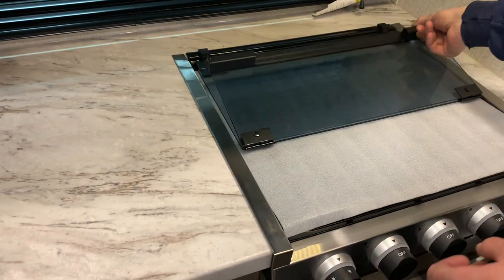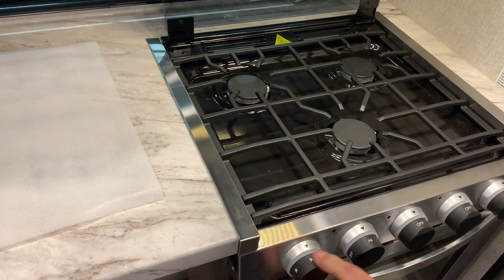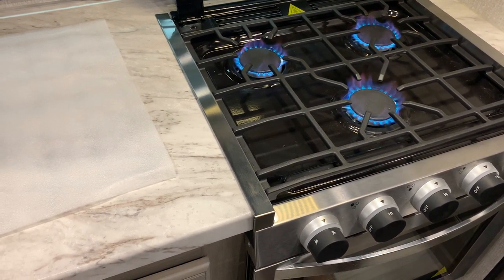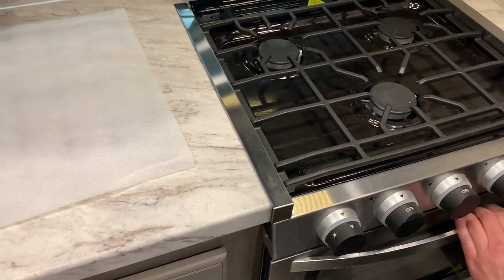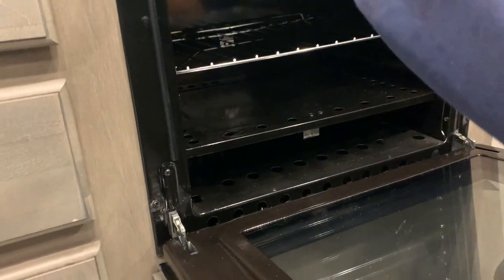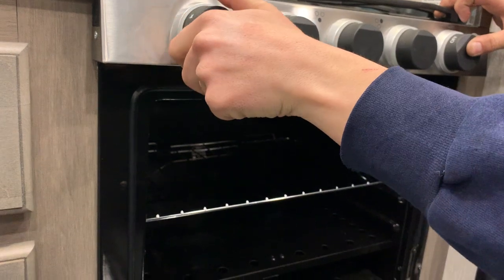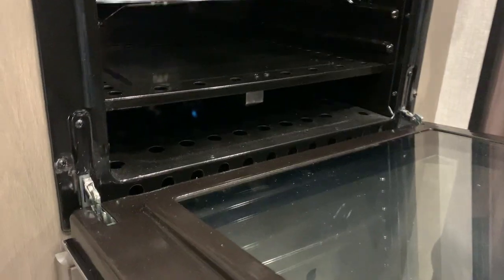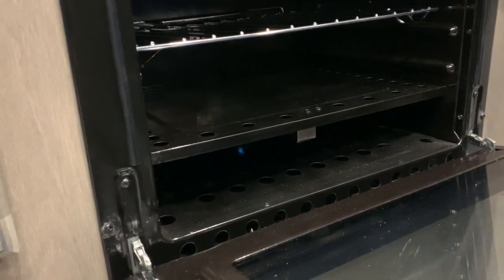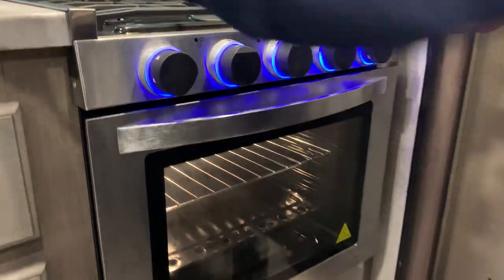You do have your oven and your stove. The way that works is just flipping those covers back — being careful because they are glass — and then you have your dials. To get it to light, just turn it over to high, hit the sparker and it lights right on up. Now if you were to turn the propane off and leave the unit for a while, sometimes it can take a while to clear all the air out of the lines, so just be patient if it doesn't fire right away. To get the oven to light, turn that over to the pilot option, push that knob in, and just hit it with the sparker. Keep trying it until it goes — hold it for another second once it catches and then turn it up to your desired temperature. Pushing this button also turns on your knob lights and the bottom light in your oven. Always make sure you let the stove cool off before you fold the glass cover back down.